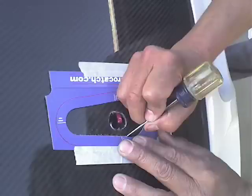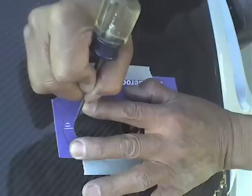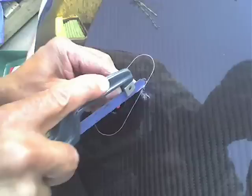Using just a counterpunch to etch in around the outline of where we had placed the cutouts, we ended up with a perfect guide to show us where we should cut. Our first thought was to simply drill an entry hole, and then take a hacksaw and etch our way around. This was tedious. So we just spot drilled the whole thing out.